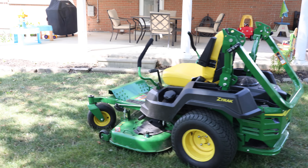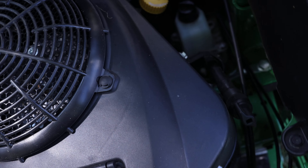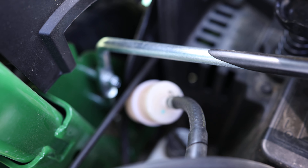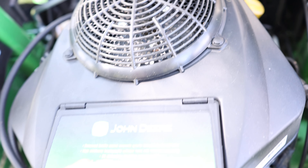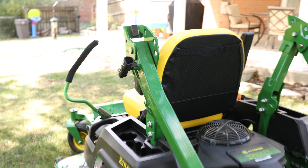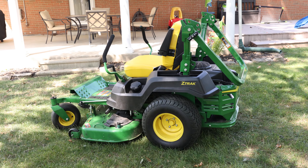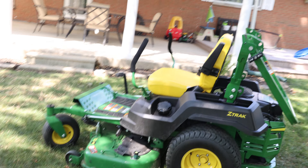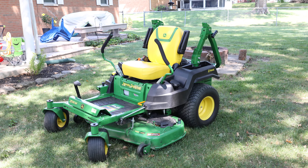The second thing that I really like about this is it's very easy to service. You've got the oil filter kind of buried down there and a nice little drain. The fuel filter is real easy to get to and find. The air filter is easy — that's a Kawasaki thing, all these air filters are easy to change. The hydro is easy to drain and service. Most of the stuff you can get at Lowe's. You can get the blades, oil filter, spark plug — everything for this at Lowe's. The hydro fluid you can order directly through John Deere. It's just really easy to service and maintain.